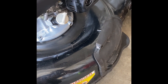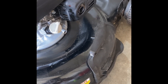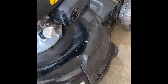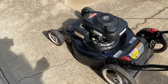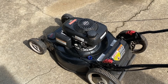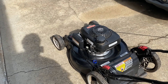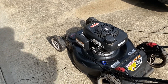So that's how you put it in, and it can be a little tricky. I had to bend the deck a little bit with Mr. Persuasion — a 2.5 pound hammer — to get enough room to put the snap rings back in. And it works now. The part number will be in the description, and a link to Eliminator Performance's video that describes this bearing and how it's hard to find on parts sites. The particular one he was dealing with was a rear-wheel Husqvarna, but I'm dealing with the front wheels here.